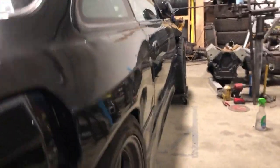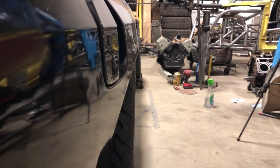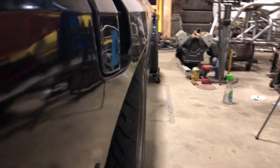This is the side aligned where it's supposed to be, about negative quarter degree camber — that's what I like to run on the cars for some side grip. And that is plenty of room. I can fit my fingers in over top, and there's still a ton of room for it to compress under.